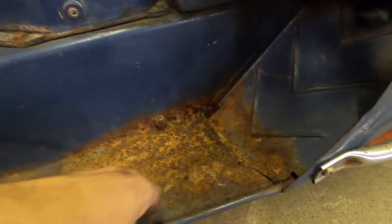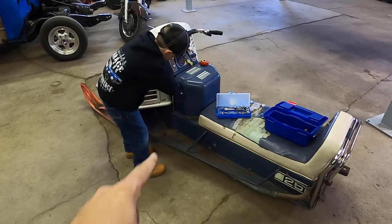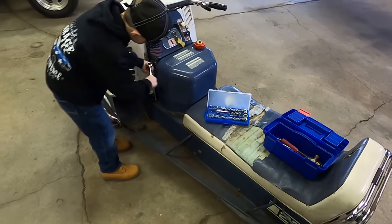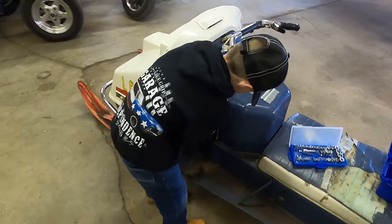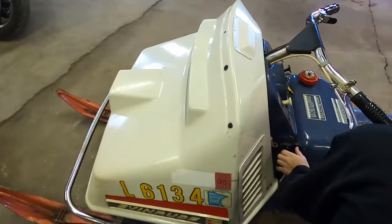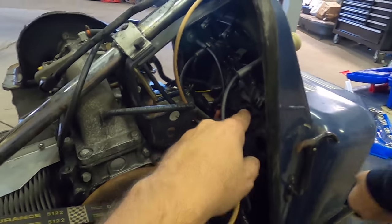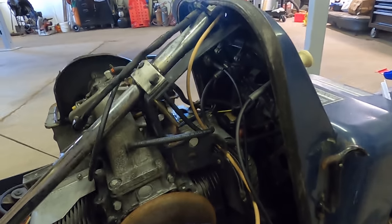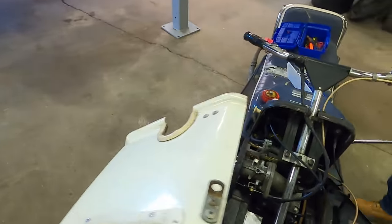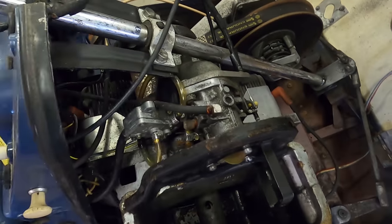It does have a little drain there, and she does have some newer RTV. My guess is they've just been draining it here, which is not adequate - look at how high this drain is relative to the bottom of the tank. So we could have a lot of crud in here. The rest of the machine is pretty good, but obviously I couldn't buy it without some sort of rust. My youngest, Bentley, is with us today - he heard about the snow machine and would not stay home. So I've got him taking the fuel tank off, and I'm going to go find a socket for that fuel line.